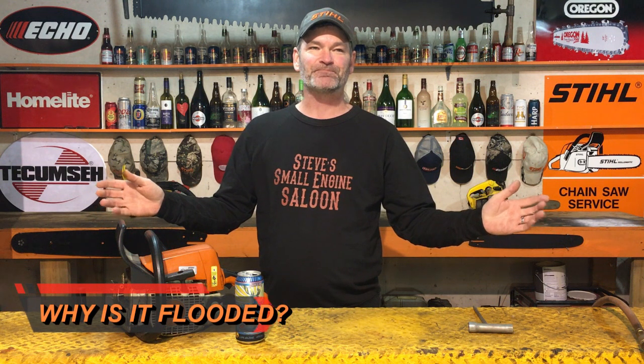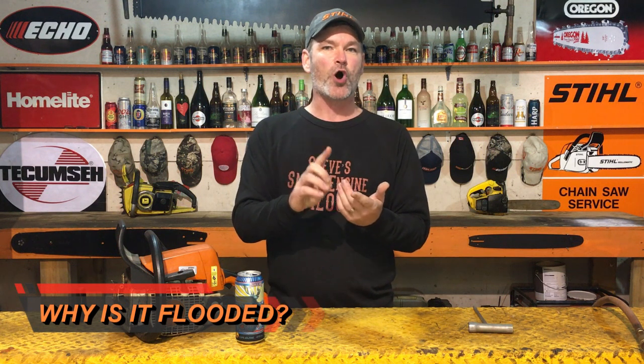Now, the other thing is, why? Why is my chainsaw flooded in the first place? I can think of, right off the top of my head, three most common reasons that it would be flooded. The first one is from over-choking. Over-choking means that you go to start your chainsaw and you have it on choke and you just keep pulling and pulling and pulling. Every time you pull it on choke, it's firing more fuel and more fuel into that engine. Now it's flooded. It's not going to start.